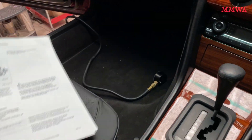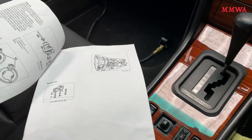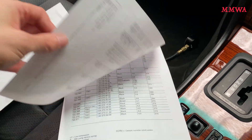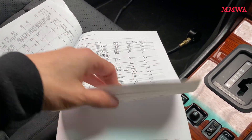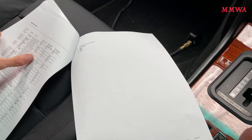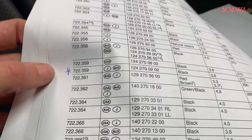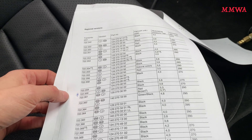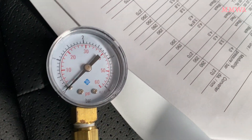Now, ideally the hose could have been a little bit longer, but it's still usable the way it is. I'm just going to find my version of the transmission in the documents. I have clearly identified it so I could find it somewhat easily in future. It's the Australia version 722.359, and it should be 3.8 bar modulation pressure with vacuum disconnected.